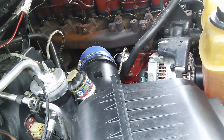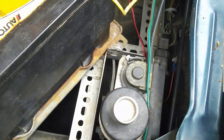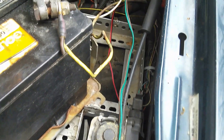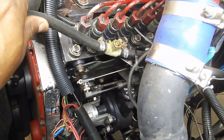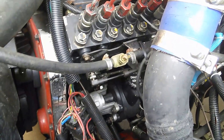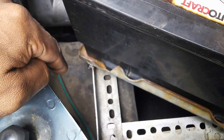Coming over here is a big one: this is a cruise control servo from the Ford Explorer, I'd say 98 to 2000, came off a V8. I will put up the wiring in the comments because I've got cruise control working on this Fummins — it works off the horn switches. This is working on a '99, I'd assume up to '03, but check. The cruise control is super easy to wire in. The ABS controller is right underneath that plastic cover there — you just need one wire off that.